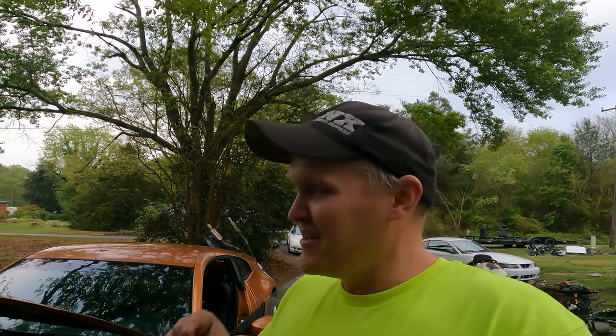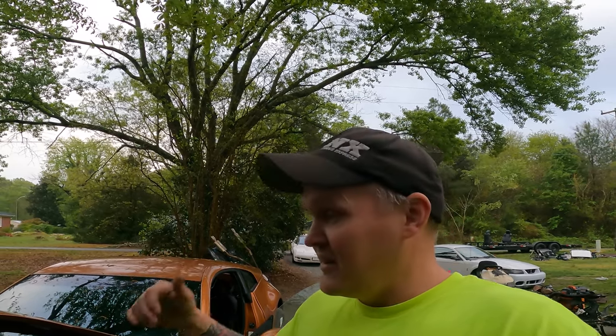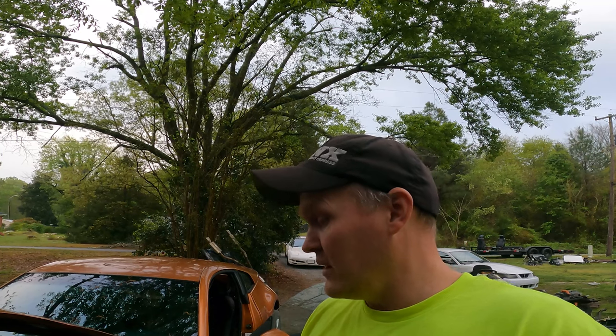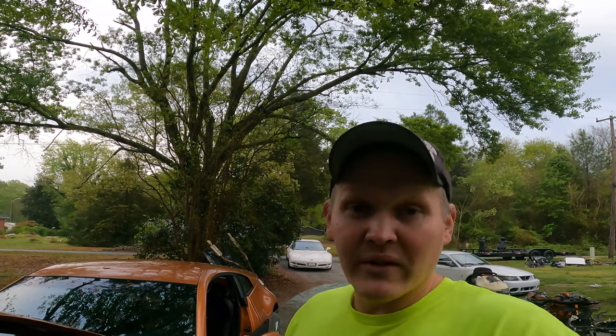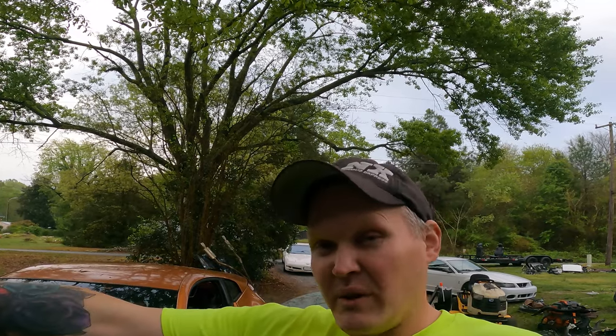And let me tell you, if you find a car that has a lot of mice in it, you are in for a headache. I don't care what anyone tells you. You may get lucky, but I'm telling you, they will destroy a car. Like I said, they get in the exhaust and clog it up. They build a nest, and then you crank the car up and it blows the nest and covers it. So I might rev it and clean it out, but I don't really care for that muffler anyway, because the mufflers that go across the back of the car make it really hard to jack it up when it's low, because you don't jack up at the pinch welds.